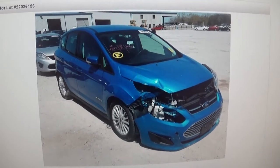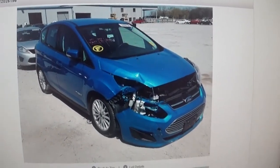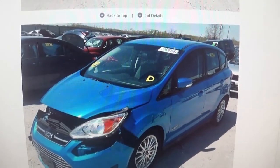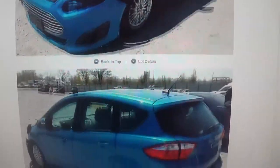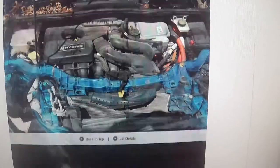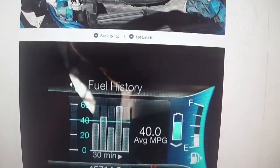So that's the C-Maxx when we got it. We got it on Copart — the insurance pool. It was an insurance vehicle and you can see what the damage was. The hood needed to be fixed, the bumper had a big hole in it right here. We will have a video on how to fix the bumper perfectly without buying one. It had a headlight actually broken inside of it, so we fixed the headlight too and reused it. On the back and the sides everything looks good. It didn't have the roof rack — that's the one we just installed out of the Mercedes ML320. There was no damage to the radiators or anything like that. We had to pull a little bit right here because it was a little bit twisted, but it was good.